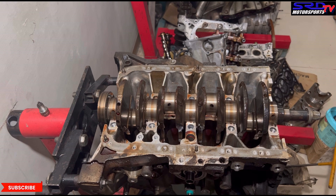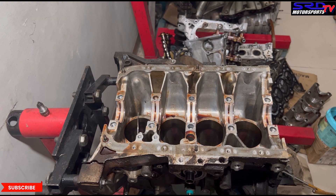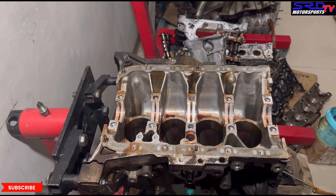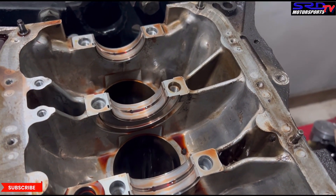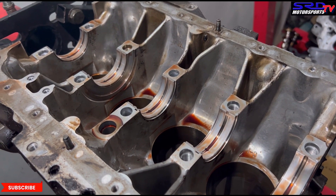Now let's remove the crank. The thrust washer fell — got that. Don't drop the crank. You can see the engine is in pretty good condition. Let me move closer — look at that, this doesn't even look like it has 97,000 kilometers. This is a crazy good condition engine. The brown color is just the oil — this shows it's a well-maintained engine. When we open other neglected engines it's all dark, and that tells you it wasn't taken care of.